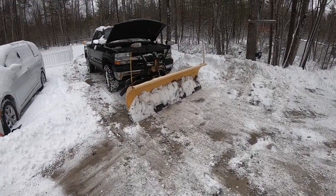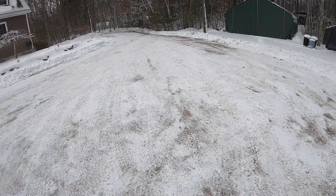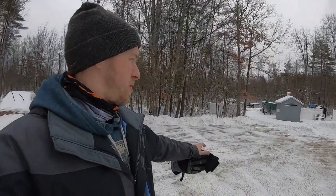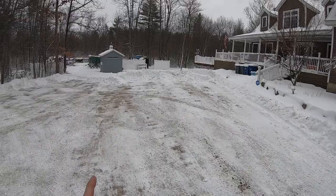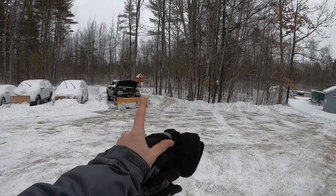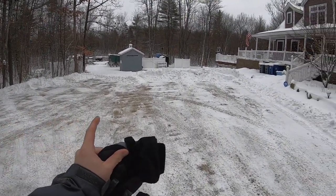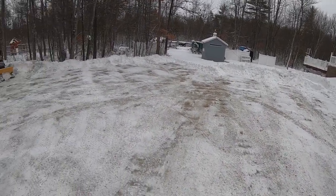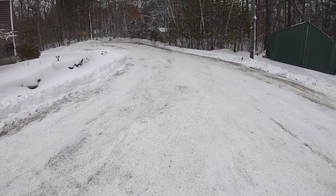We had to put the kids to bed so we parked the plow truck for now, but let's take a look at what we did so far. You'll notice there's not a single snail trail. A snail trail is when snow bleeds out from the side of the plow. Keeping it angled to one side and making passes — shaving, if you will — pass after pass, keeps that from happening. The plow has markers on the side — you always want to keep those on previously plowed area. If that marker is in the snow you're going to leave snail trails. We just shut the truck off and we have absolutely no snail trails up and down the whole driveway.